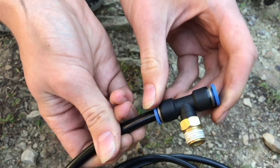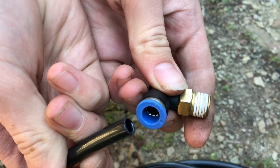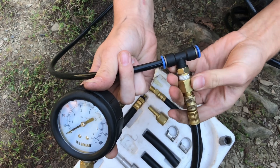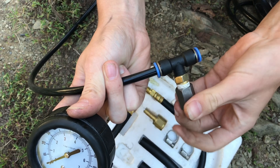These compression fittings work really well with this nylon gas line, and you just pop it right off by pushing the blue washer. They also make it in a tee, so if you ever wanted to do a pressure test on the fuel line you can pull this cap off and you're ready to go.